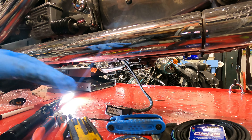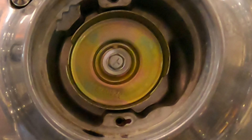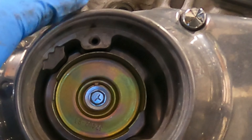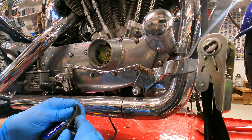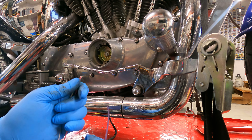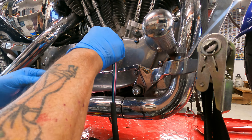The directions for this Dynatech say you have to use the gold-colored cup, which has part number 832402-83. You have to have this gold-colored one — the silver-colored one, which is for the other ignition module, won't work. So if you have an earlier Sportster, you'll have to get this gold-colored cup. Now I'm going to feed this through. The pink line on the wiring harness and the white and pink go to the coil, and the purple goes to the VOES. There are not many wires on this.